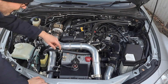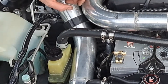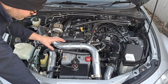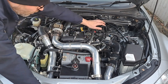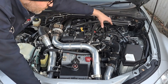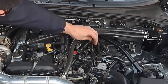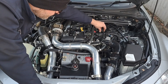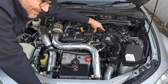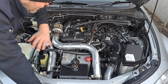On my setup I've got a blow-off valve which is hidden down here. The blow-off valve basically wants to measure pressure on the intake side of the engine — you're wanting to measure what the intake vacuum is. When the throttle body closes, the vacuum in the intake changes. This hose comes directly from the intake — it was the purge valve takeoff — so this is an intake source, measuring the exact boost or vacuum you have in the engine.